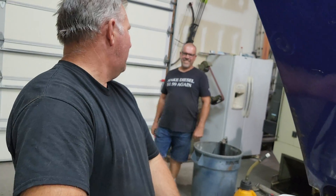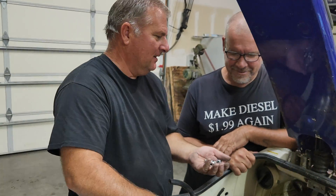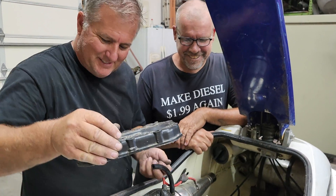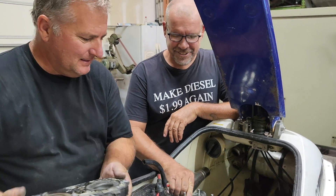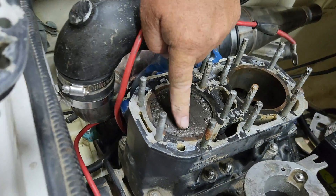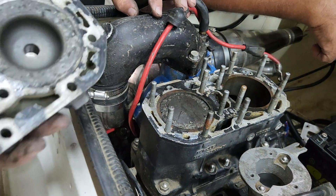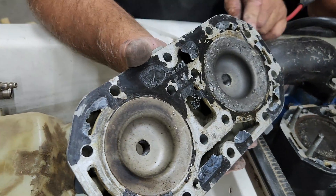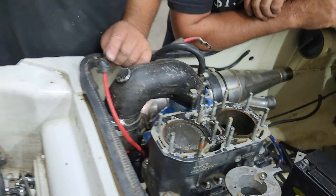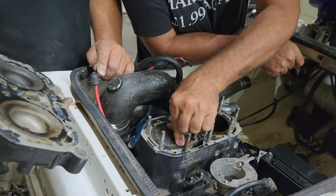Jimmy, what are you doing? Working on junk. What are you doing? Boy, this is a man too. Hey, I think I figured out why this has low compression. Why? I just took this off without tools. That's never a good sign. Oh my goodness! Where's the gasket? There isn't a gasket — you don't need no stinking gasket. There's no gasket. So this here, this is processed engine parts — this is bad. Which means the crank is probably bad, which is why it turns over slow. And the head is bad. So we may have to condemn this motor. But that's okay because we have more. There's parts in there. What did it process? The bearing? Probably. It ate something.